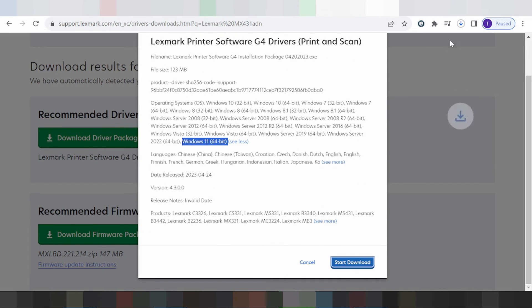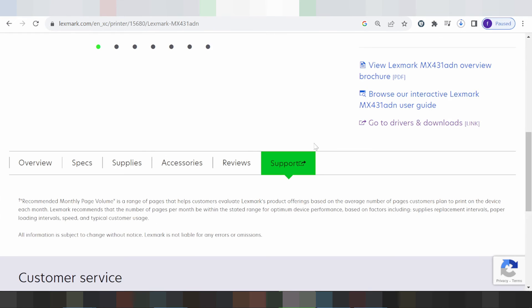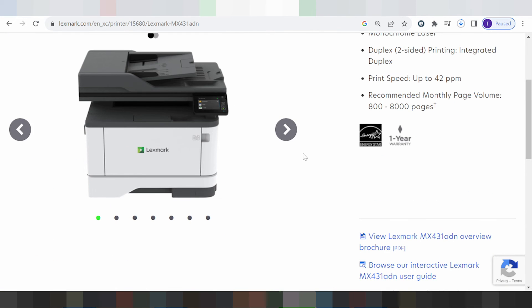This here is your driver download. If you need to install the driver for a new printer, turn on the printer power, put the USB cable from the printer to your laptop or PC. The laptop or PC will detect the USB cable. Wait for it to finish loading, then double-click the file, click Next, and click Finish. This will automatically detect the USB cable for the printer.